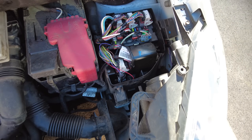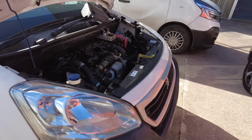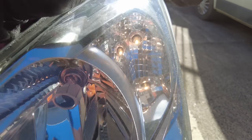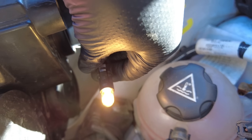I already knew that, mostly because I know these vans quite well electrically and the BSMs are really common failures. I've got a replacement BSM with me, we're going to get it swapped out quickly. With the new BSM fitted and the sidelights back on, you can see the nearside works — and now so does the offside.